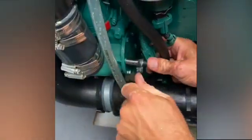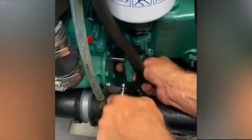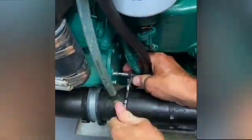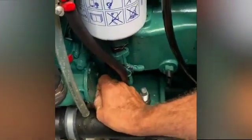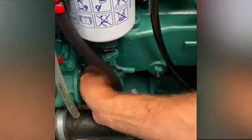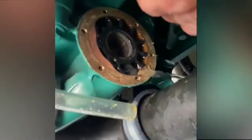For this process you're going to need a low-profile socket wrench, as some of the tight bolts in the back corner are pretty difficult to get at without one. When you see some water start leaking out, it's not a problem as long as you've shut off the seacock at the water inlet. It might just be a little bit of water coming out from the sea strainer.